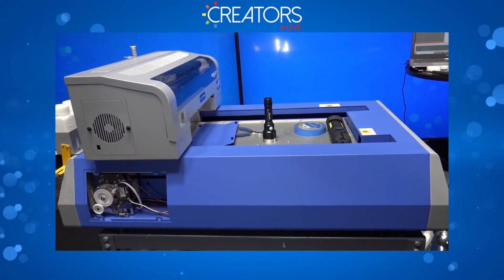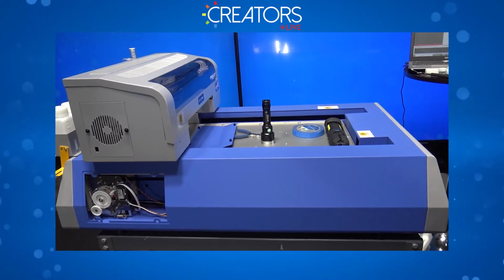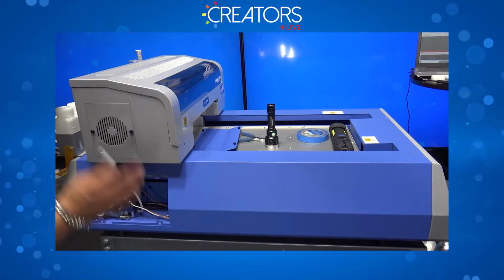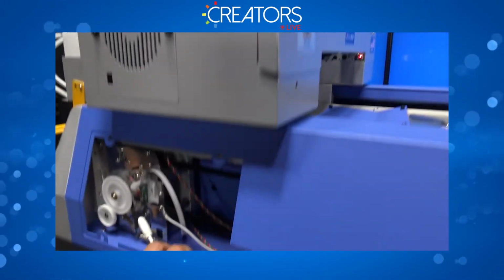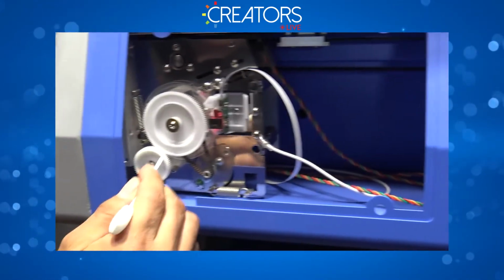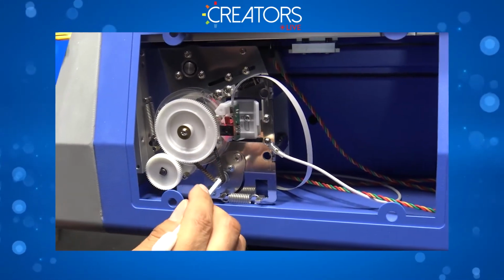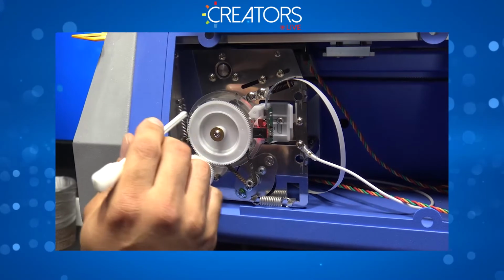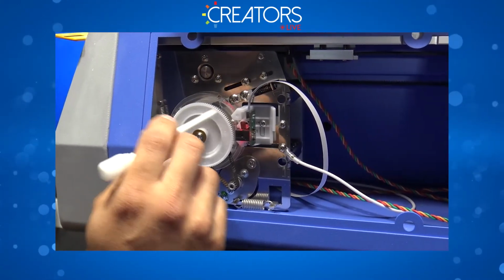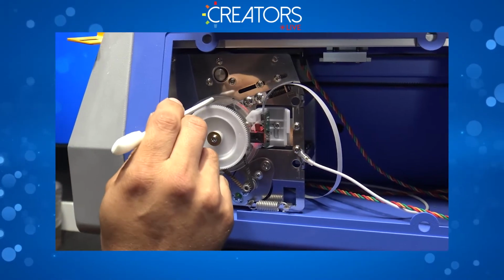And what you're gonna need is a new swab and alcohol again. Okay, so this right here is your gear that gets in motion due to this other motor right here. Your encoder wheel is this one right here, the clear disc behind this white gear. This is the one that we need to clean.